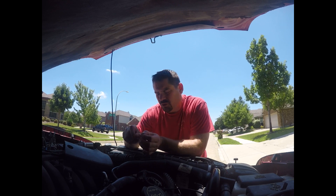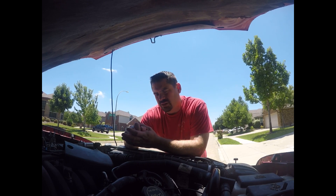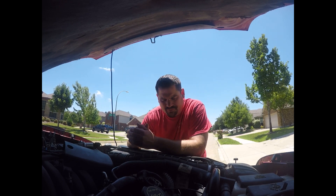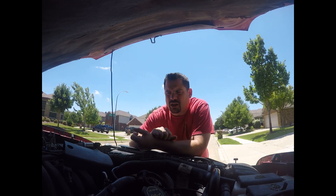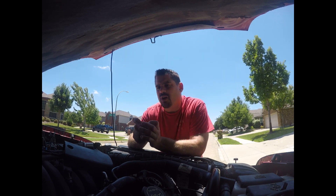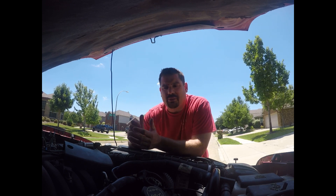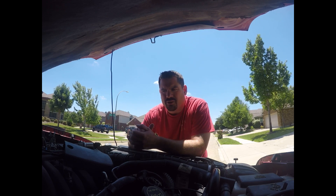I literally had to scrub down my harmonic balancer — the dampener, whatever you want to call it — to find the marking, and that was the hardest part of the whole process. Then all I did was rotate the engine from the bottom and put the gauge on to see when I was getting a compression stroke. And believe it or not, it was off — not by a huge amount — and you'll see in the video that the cam sync was off a little bit. So if you're going to install a cam synchronizer, this is the preferred process. Because if you're not the original owner, how do you know that the cam sync was in the correct position?